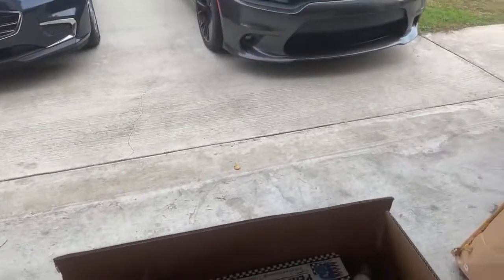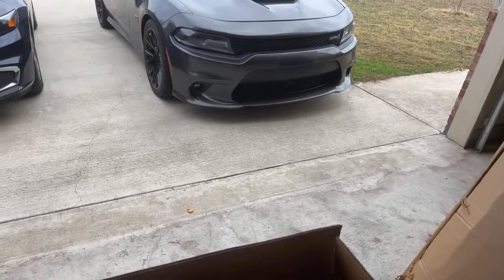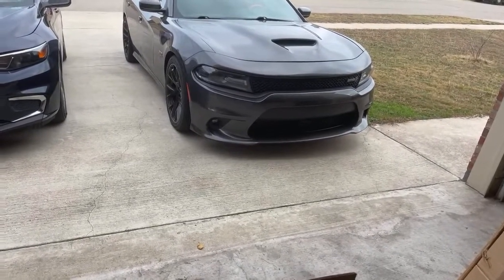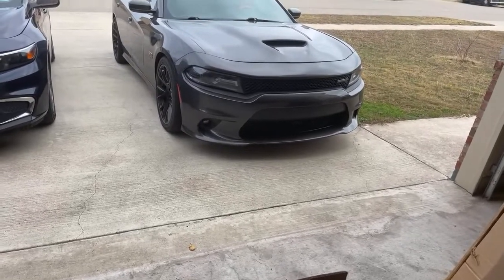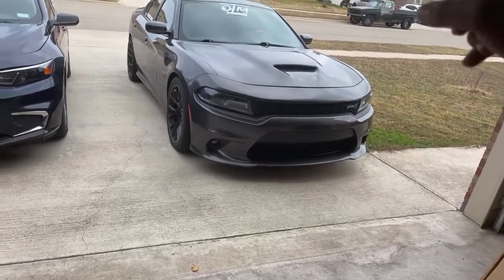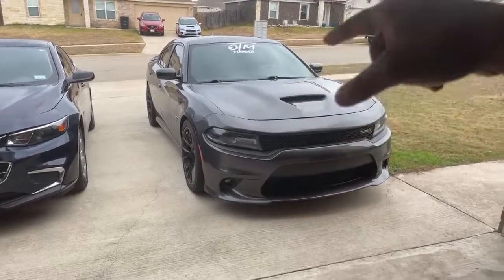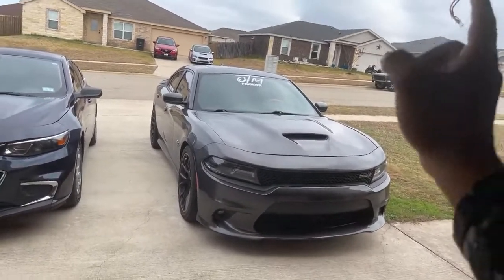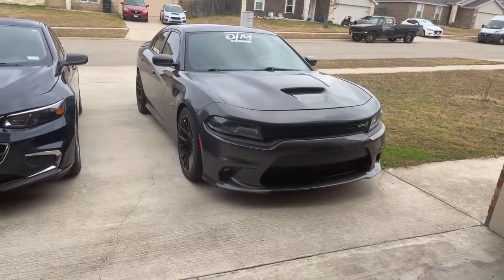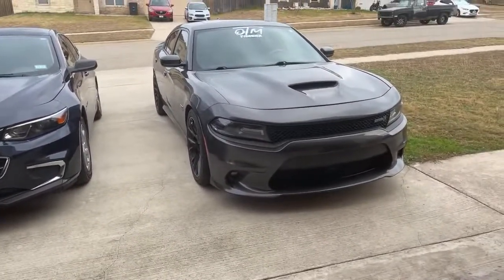That torque converter came from Hector. He switched to the 1320, and then he upped it again. I forgot which one he put in after that, but he's now running a bigger torque converter that can hold a lot more power than even the 1320. The only thing I wasn't able to catch off him was the drive shaft. He swapped out his stock drive shaft for, I think, a 1,000 horsepower drive shaft, and then he swapped that one out for another upgraded drive shaft. Somebody bought that before I could get to it. But you're gonna have to upgrade your drive shaft as well, front and rear. Axles, I already said I got axles on the way that can hold up to 1,000 horsepower.